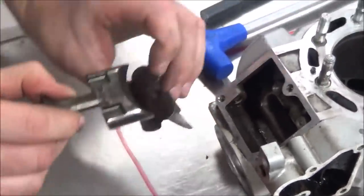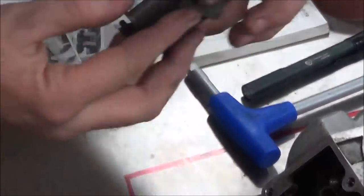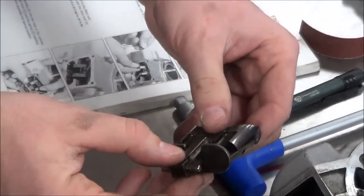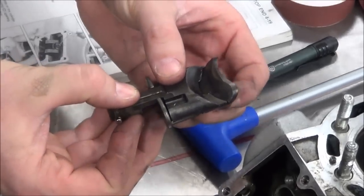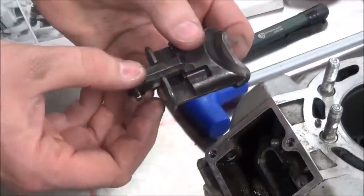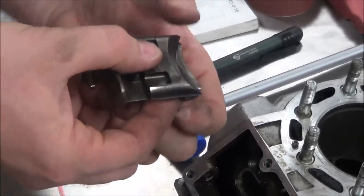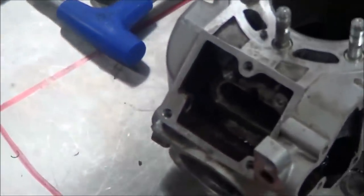It's just that dirty. Take a look here. Do you see how this power valve even has the ability to open like this? It's spread apart, so there are a lot of places for it to gum up. When this goes far enough open, this body hits this, which causes this valve to open up even further - it's an extremely adjustable situation. The hole that's underneath here is what we're trying to accomplish. We're going to set this here, get it cleaned up, and take a look in the cylinder now and see how much carbon buildup we actually have in there.